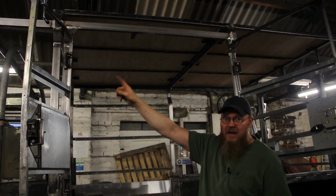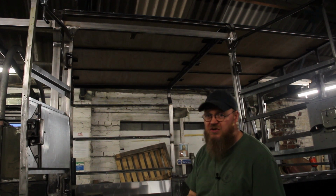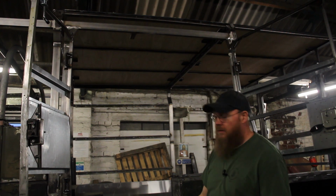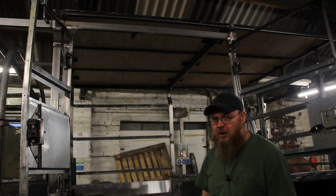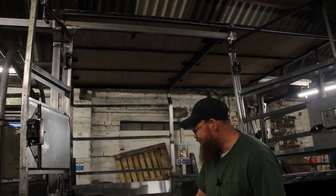And in the corners here, like I said, I'd reinforce them with some box section, some 2-inch box, 3mm wall. I had huge stuff, but it was what I had, and I wasn't going to go and purchase some more 2x1 just to do those.